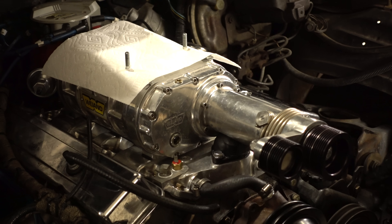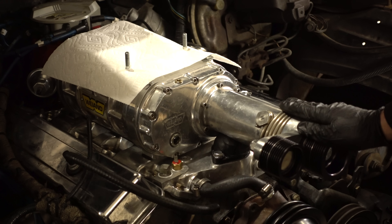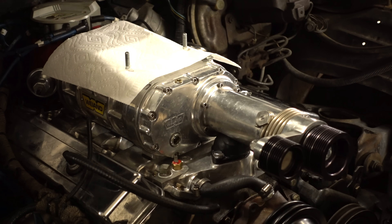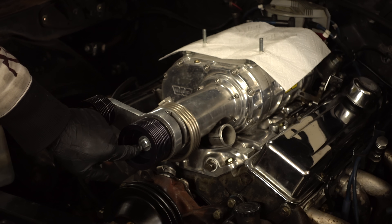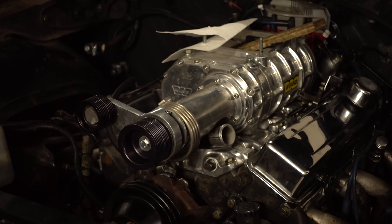So now the supercharger is filled. It's good to get that done just to make sure there's no chance of forgetting to do it, and it might be a little trickier once there's a carburetor on there later on. So just to be sure, I'm going to go ahead and remove this bolt and torque it to the spec in the book, which is 30 foot-pounds. I'm just going to put this piece of wood in here to make sure it doesn't rotate.